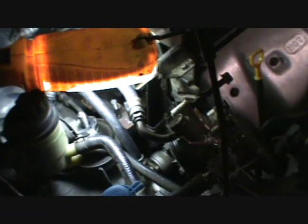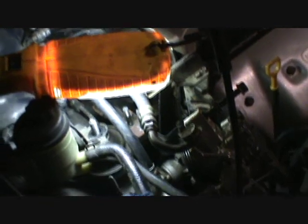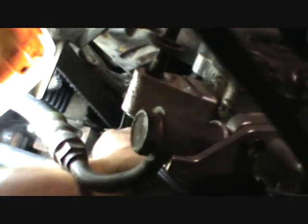And you've got to change them. But anyway, I'm not going to do that water pump this time. These don't get as much load on the bearings as ones that have like a fan mounted on them, like the older cars. So this one feels good, and it wasn't making any noise.